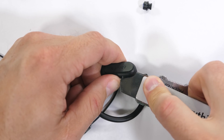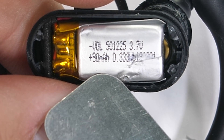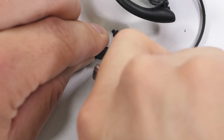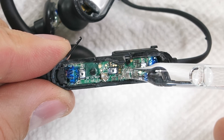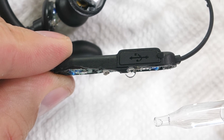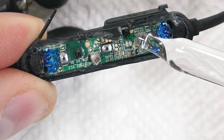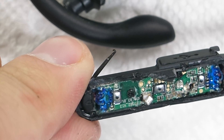Taking my metal pry tool to the battery housing, we pop off the Anker logo to find a 90 milliamp hour battery powering these headphones. Sliding down to open up the watertight controller housing — which is rather difficult considering the amount of rubber and glue holding it all together — we see these headphones have the same impermeable nano coating over the circuits. Still not hydrophobic, but thick enough to keep liquid, and more importantly sweat, from corroding the internals. Are they really the world's most sweat resistant headphones? Only time will tell, but the teardown shows there is a coating on the circuit boards and they should be able to hold their own.